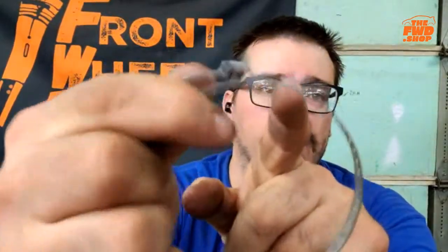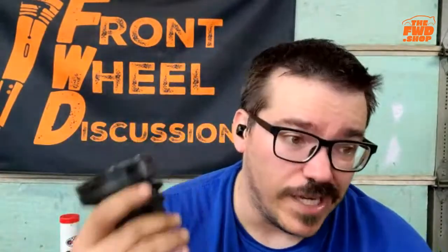These are also very easy to take off. That little part that sticks up from the ends, grab that with a pair of diagonal cutters and pop it off, and they come right off. Okay. So there you go. And if you find that you just need a boot, if you've got a good axle, it's still lasting, it's worth putting a boot on an axle, especially one that you know is good.